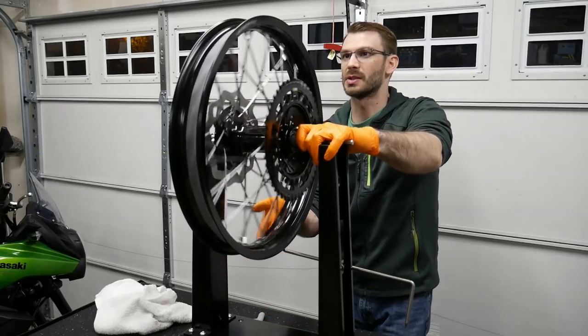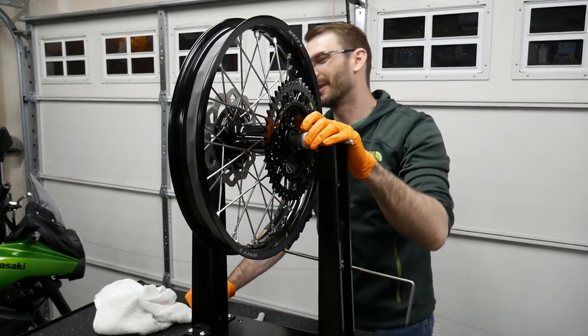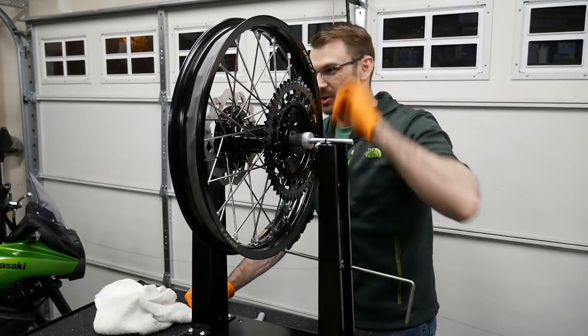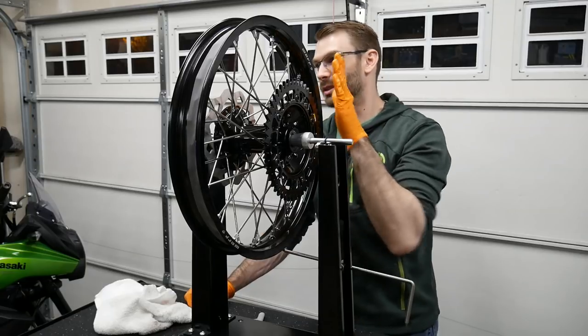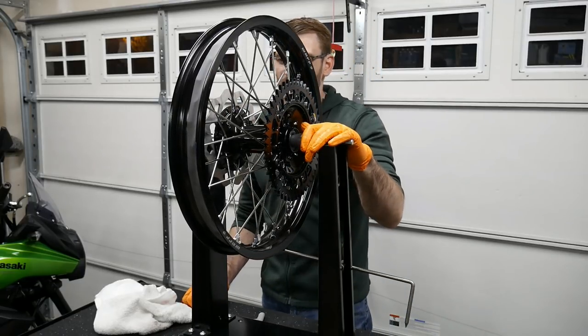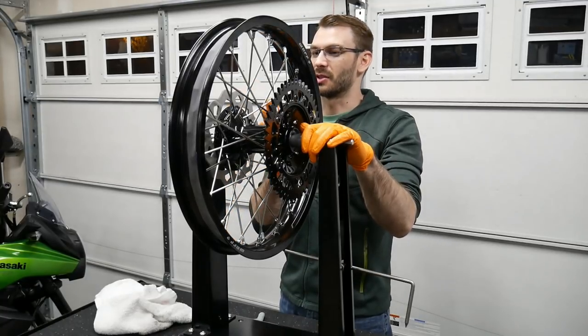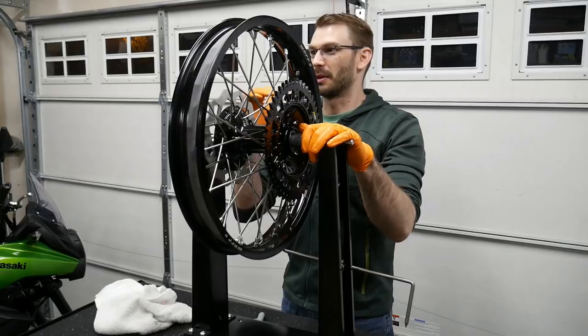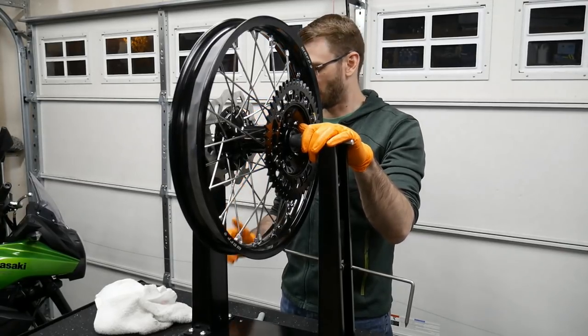It's pretty good. You can tell when you're getting it close, when you can tell where the weld seam is when you're spinning it, because the weld seam causes a little disruption in the wiggle. It gives a little wiggle to it. So you spin it around and everything else is so tight, lateral and vertical, but then the weld seam starts to throw you off because it causes a little bit of a visual thing.